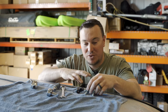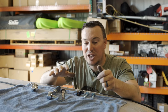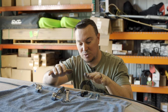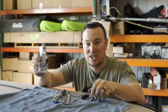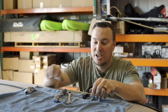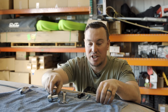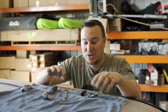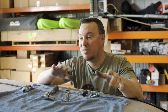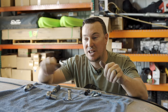So we finished cleaning the roof and prepping it. Now I've just staged the hardware at the mounting locations. Two bolts and two spacers are going to be at each location, and I have our RTV silicone ready to go and the tools to install. These mounting bolts are a half-inch bolt head, so you can either use a ratchet or a ratcheting wrench — makes it easy as well. With everything prepped, it just makes everything go a little bit easier once you get the rack up here. So now we're ready to grab the rack and get it in place.